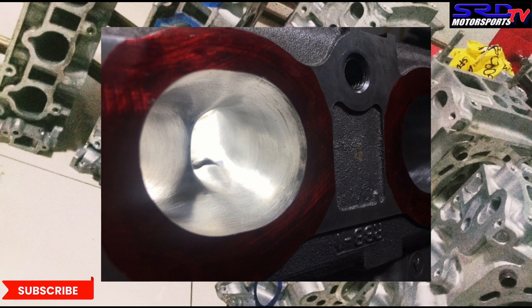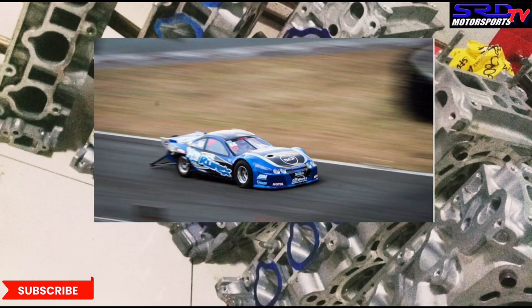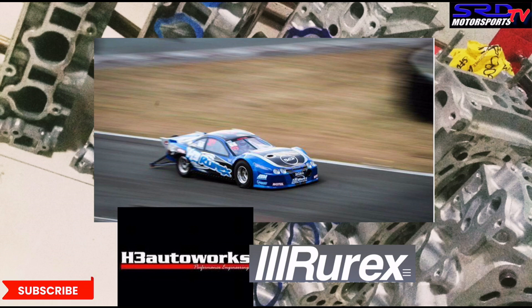What more would you make if your head was ported? And on turbo, the turbo guys just keep running up the boost. The turbos from Borg and all the other good ones keep producing more boost or more capability — it's just that it becomes detrimental. You start melting injector tips, spark plugs — it doesn't make sense. And look at this: this is Bong's masterpiece, the H3 Rurex DC2 Integra that holds the record at 8.8 seconds — it still holds it from, I think, 2013. Imagine that.